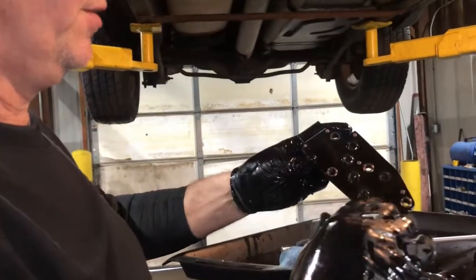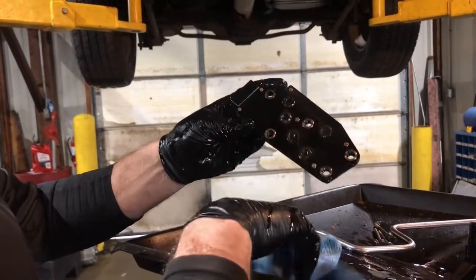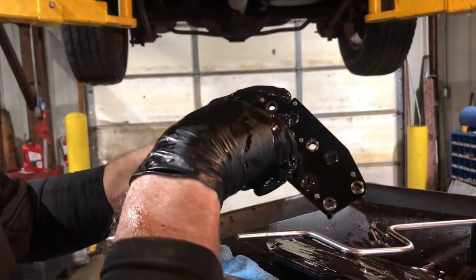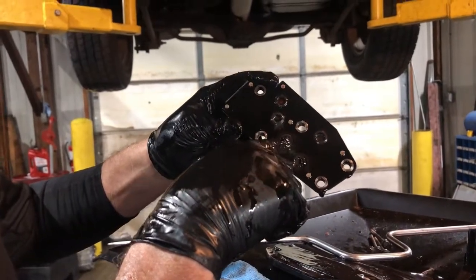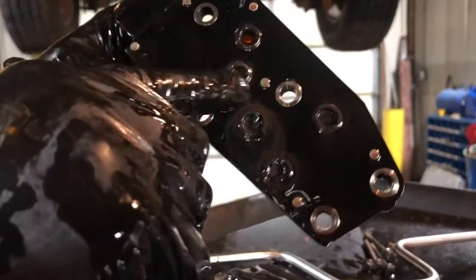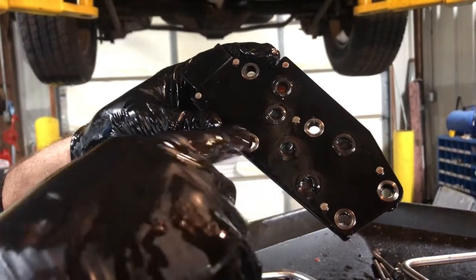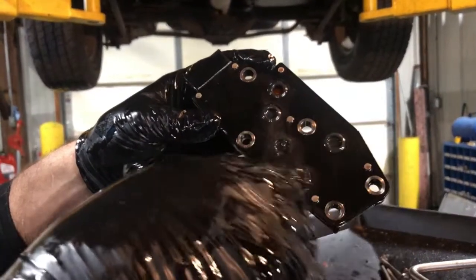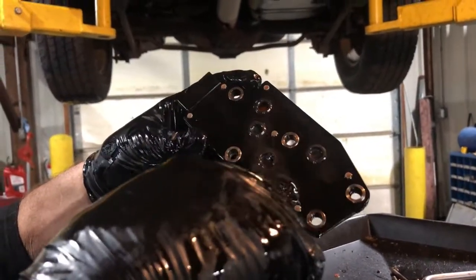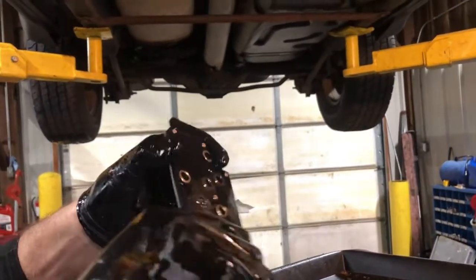I see something I don't like here, but I'll show you at the end of the video. If you see something like this in your transmission, you're going to want to make sure that you let that fluid drain as much as you can. These are your pressure switches. You can see right here how the rubber has gone off of this seal — it's used up. I think this one's bad. These can't hold pressure, so it's going to throw your pressure off and your computer's not going to know where to put the pressure because these sensors are not holding pressure. I'm going to take this in the office and clean it up.